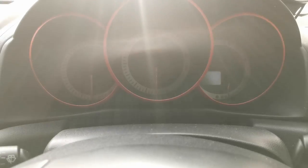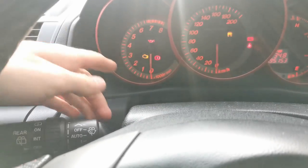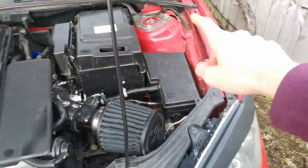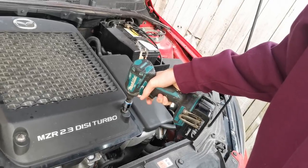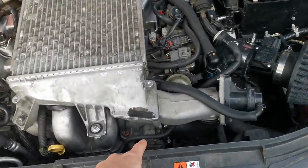Why is that bad? You can get worse fuel economy, you can also lose power, but the most notable symptom is: say you cold start your car, leave it a minute or two, and then you'll see it settle down to like 500 RPM and the car will really be rough. So we'll disconnect the battery — because it's an electronic throttle body on these, not cable.